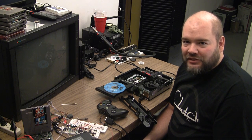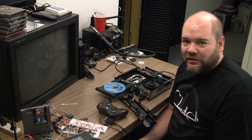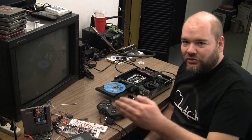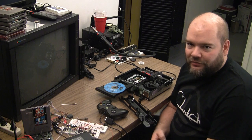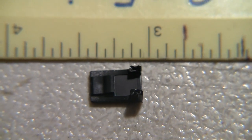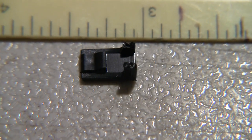What I had was a little piece of plastic inside the DVD drive, loose, and I didn't know what it was. I thought maybe it was just a mounting clip or something. Turns out it was a piece of the limit switch, and the limit switch actually tells the console that the tray is in or out all the way — and that's what was not happening. This is the little piece of plastic I found inside the DVD ROM — very, very small, you wouldn't know what it was otherwise.